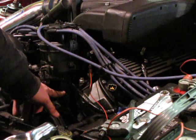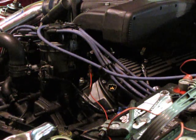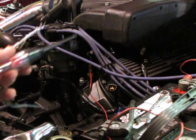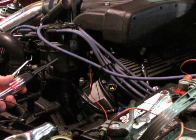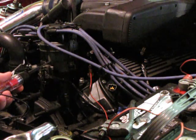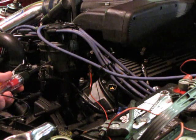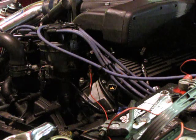You're going to loosen the bolt for the distributor, which is half-inch drive, just enough where you can move the distributor side to side, left to right. You stick these two pins in there and you watch the light. You move the distributor and you'll hear the fuel pump prime, and what sounds like the injector spring. And you'll also see this light flicker.